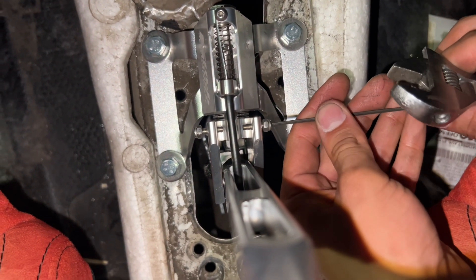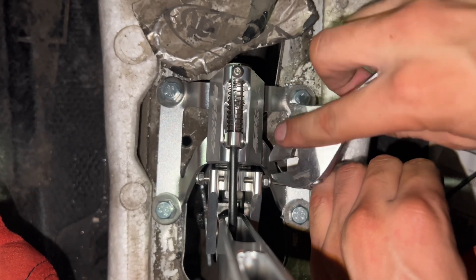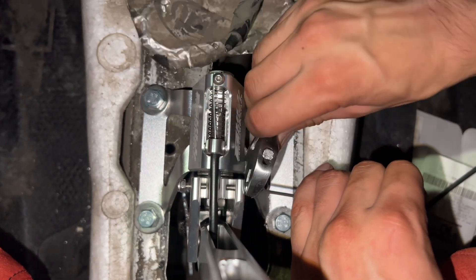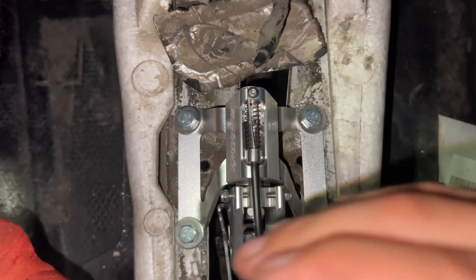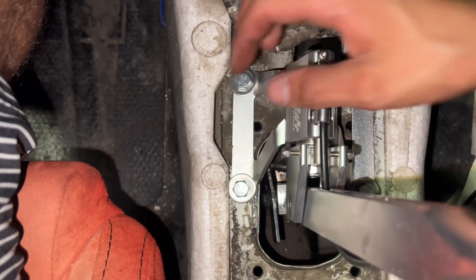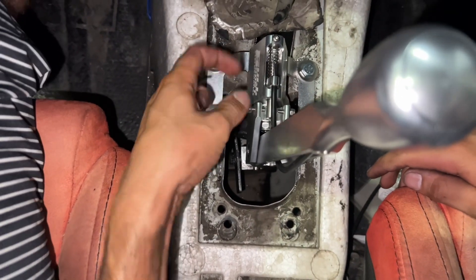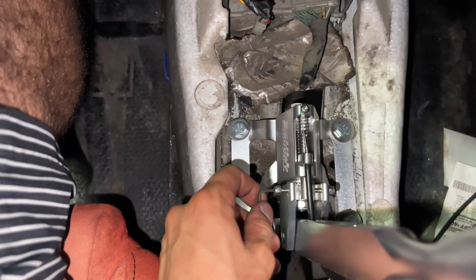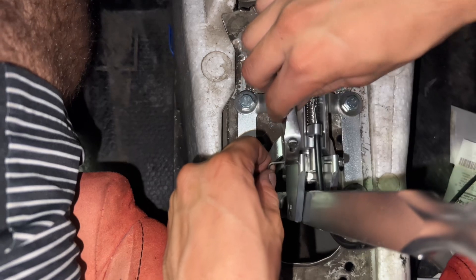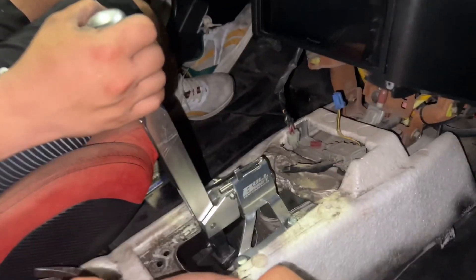You can do this for first and second, or also fifth and reverse. I'm going to do it for first and second, not fifth and reverse — once you're at that speed you don't want to be locked out of fifth. For first gear it's more necessary. It feels really smooth with a spring in it, very tight. Everything uses lock nuts so the adjustable screws stay where you set them. You hold the actual pin and not twist it, so you can adjust and then lock it in.